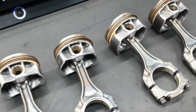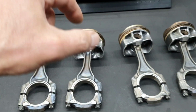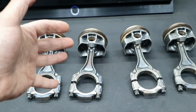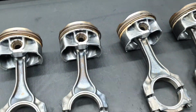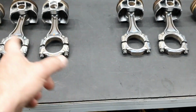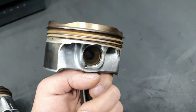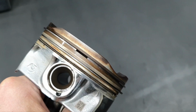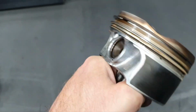All right. Then, let's open this. You know what? I'm going to secure the phone somewhere to remove the piston rings from this one. Okay. And there are more bent connectors. I said also the number 8 has a bent connecting rod. You can see here the polishing mark at this point, and you can see here. Yeah, it's okay. This one is a little bit more decent.